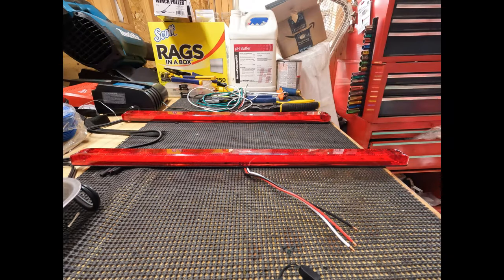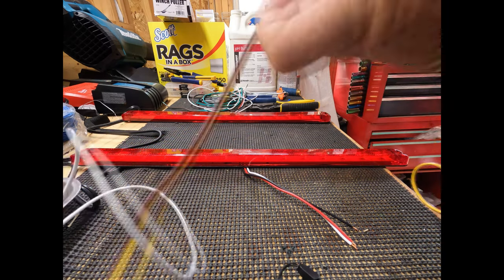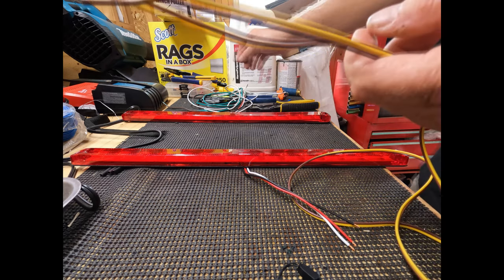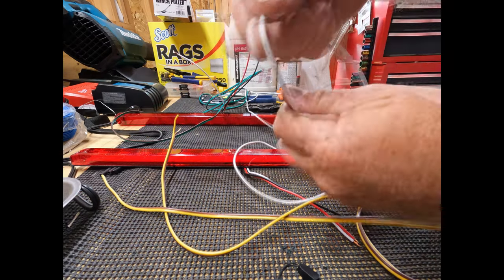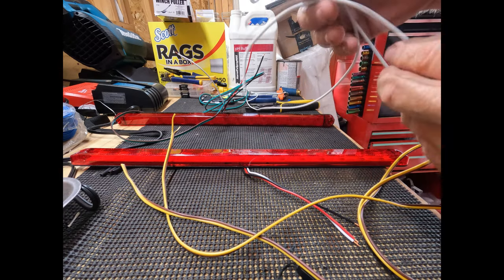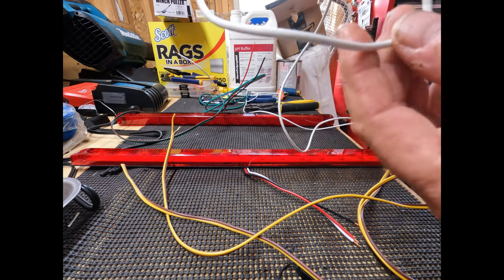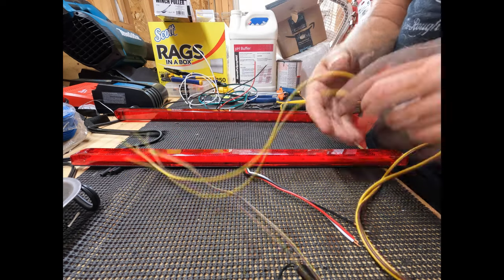And what I'm going to use for wire is I had a replacement 4-flat wire plug system, and I'm just going to use the wires themselves from the 4-flat for the lights, and then I'll add a white ground wire to each, because I'm attaching it to the camper, which is wood, so we're going to have to run this down and ground it to the original taillight bracket to make sure we have a good ground. I think I'll work on the left side first.